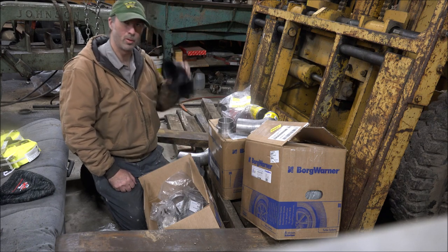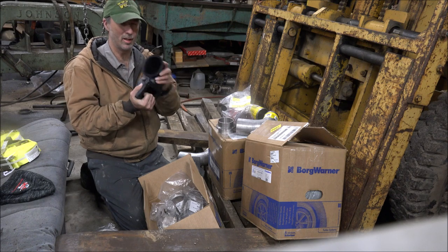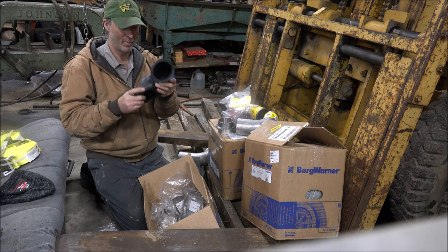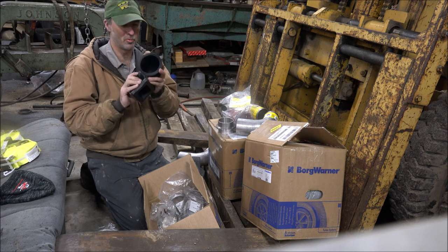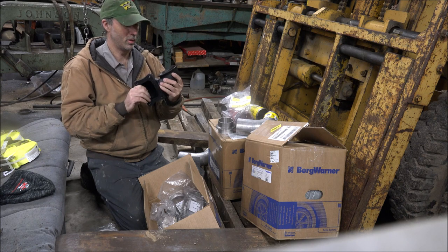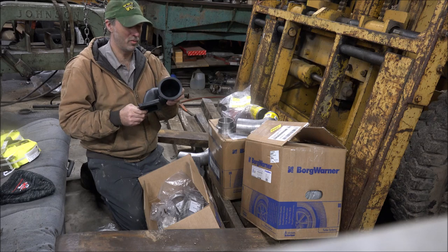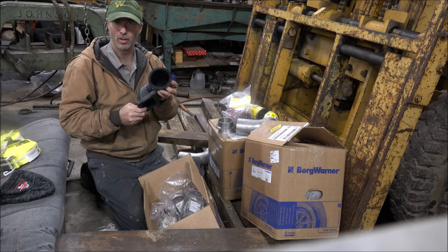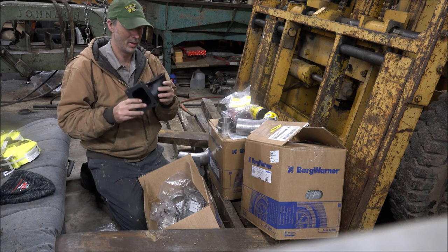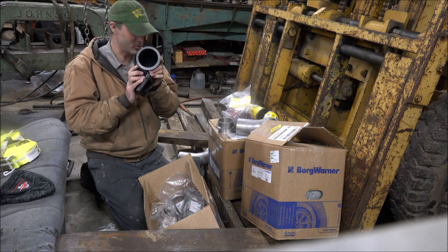That's where this nice piece of cast iron comes in — it can take the heat a whole lot better than any sort of piping I can fabricate. In the past my twin setups have been fabricated pipe, but this one is going to have a more higher duty cycle than typically what my twins see, because usually those are race trucks and they don't get a lot of run time. This is going to get a lot of run time, so this is the route I chose to go.